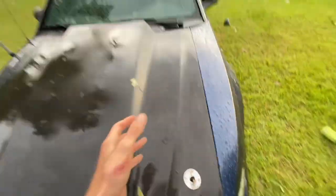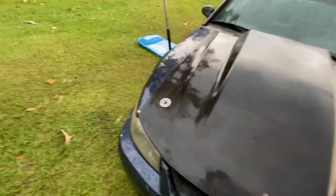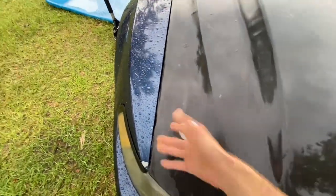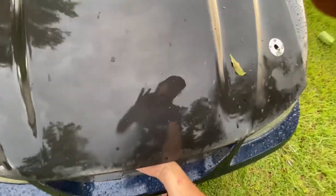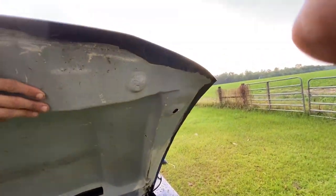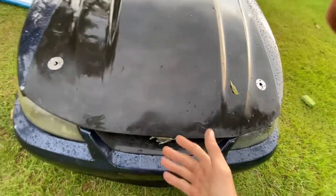The wonkiness on mine was from a tree falling on it, not from drilling at an angle. That's all it takes to install hood pins. You want to put the covers on there — you don't have to, but I recommend it. They get scratched up, but just put grease on the end of your pin, put it on, drill — that's it.